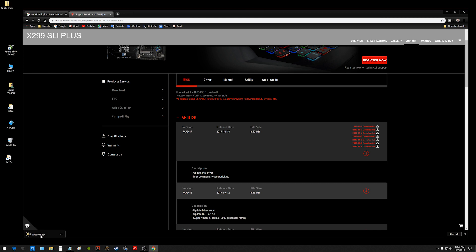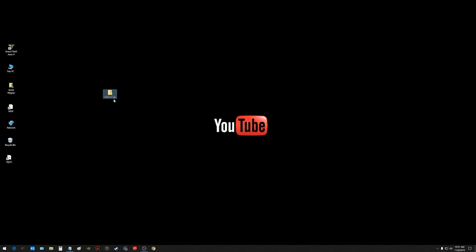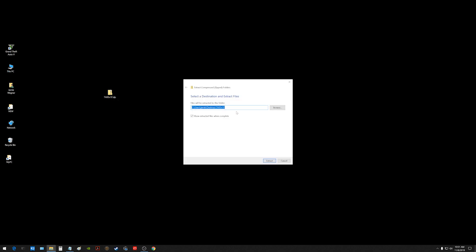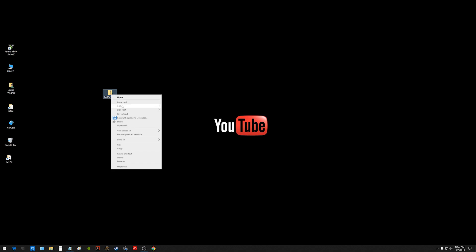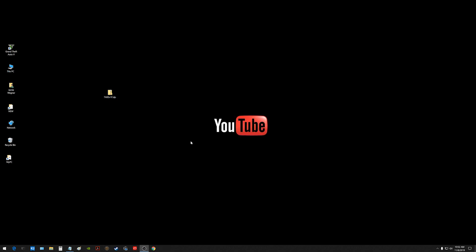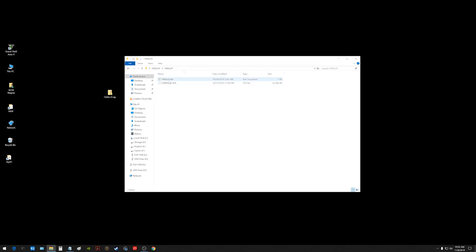That's going to download the BIOS in a zipped folder. Once you download your file you've got to go in and find it — I put mine on the desktop because I'm doing a tutorial. What we need to do is extract the contents of the file. Go over the top of it and right-click. If you have the built-in feature like I do on Windows 10, you have the option that says 'Extract All.' That will create a new folder right next to this one on the desktop. Or if you're familiar with extraction programs like 7-Zip or WinRAR you can do it more quickly. I'm going to use 7-Zip, go to 'Extract Files,' and click OK. That creates a new folder, and inside we find the files we need to flash the BIOS.